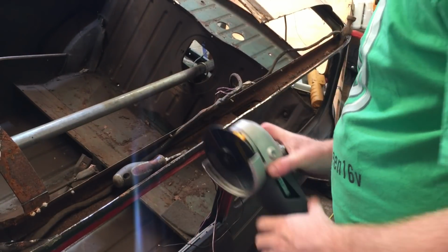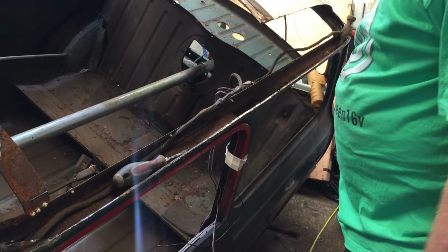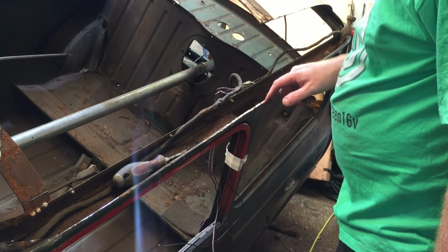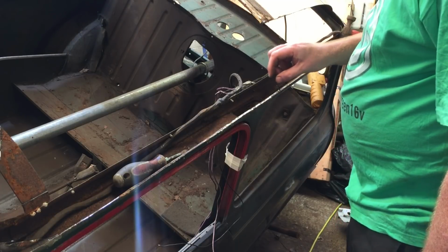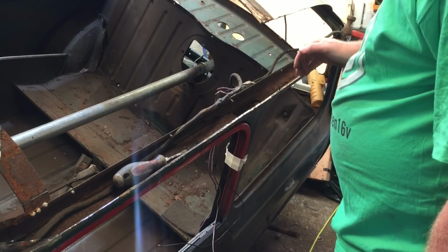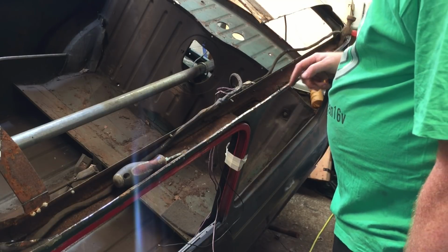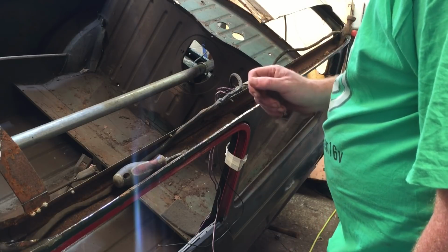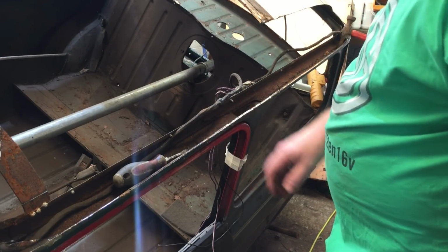I just tried to use a slightly thicker cutting disc to help me grind. It didn't seem to work as well. It seemed to work a bit better on the actual bits where I'm running two thin slices down either side of the weld, and obviously the roof comes off with that side, and then you're just left with a little ridge, which seems to be a bit easier to grind with a big grinder.